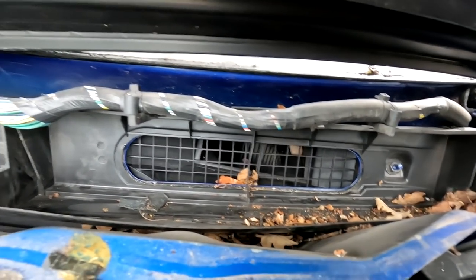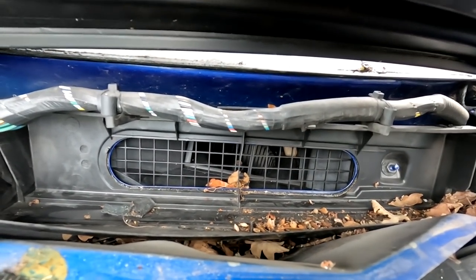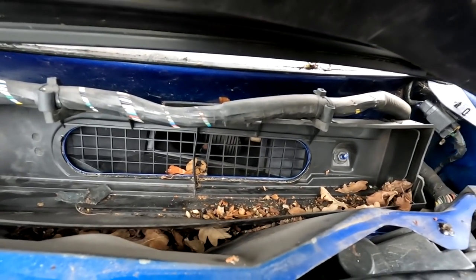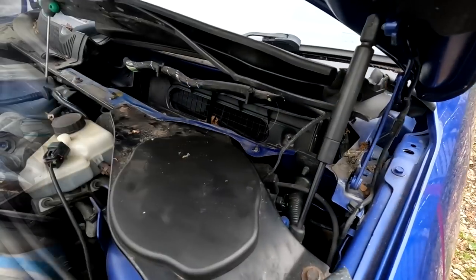Found the point of entry - for the mice, see the seed pods down there? And also down the edge there - they've not fitted the pollen filter properly, so the mice got in the car that way. Just lean that forward like that, lift that out. And as you can see it does need changing, folks - it's pretty dirty. All the way up there in the creases - thick, absolutely thick with it. Right, get rid of that. There's our fan motor there, and believe it or not mice can get in through holes like this and get through that. So I'm going to give all this a hoover out now and then we'll refit the pollen filter.